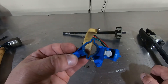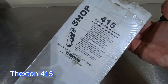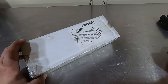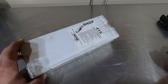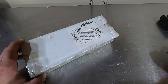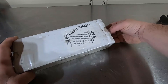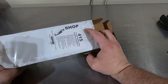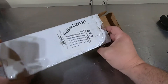What I have here is a handy tool called the Thexton 415 Ford distributor gear installer and remover. This is instrumental in disassembling and reassembling a Ford TFI distributor. However, I have to stress — this is for a stock housing TFI distributor. It won't fit on an MSD for reinstallation of the gear. It will remove gears, but it will not fit an aftermarket housing distributor for reinstalling the gear.